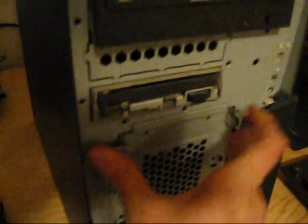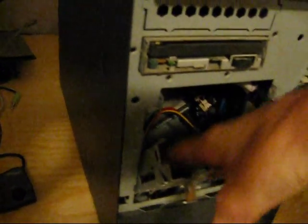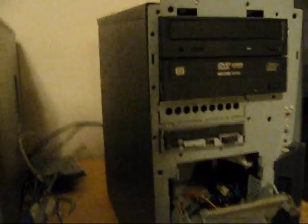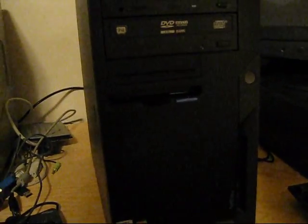There's the floppy drive, blank for another floppy drive, or whatever the hell you would want to put in there. And this is a quick way to get the hard drive out if you don't want to take off the side panel. You can just do that, and there's two tabs here. That's where your hard drive would go. Of course, I don't have a hard drive in it right now because the Deskstar that came with it was dead. I went up the rails on this other Seagate drive I have, because I have about 20 of these. It wouldn't fit because of the stupid rubber thing, so I'm probably going to cut that off and stuff it in there if the computer works. Now, this is a NetVista. I'll show you why in a minute. And this just goes on by putting it in like so and clipping it into place.